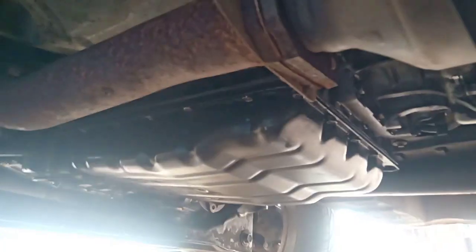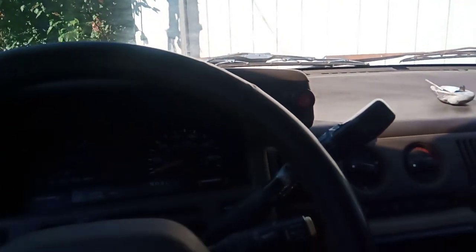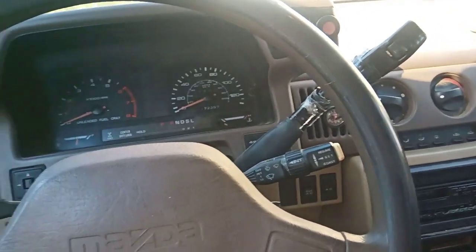Let's take a quick look under the car. This was a pain. That's the transfer case, that's the crossmember, and that's the transmission pan on top of it — a pain to get out. All of this was a pain to get out, really, because the exhaust is in the way. There are a couple of bolts you have to remove, like the transmission dipstick tube — that was a pain too.